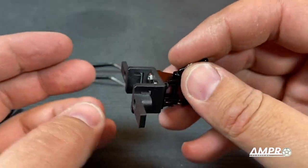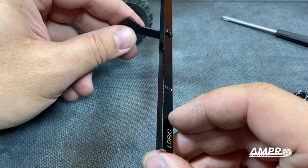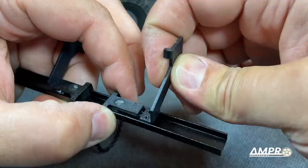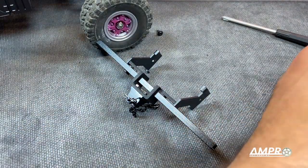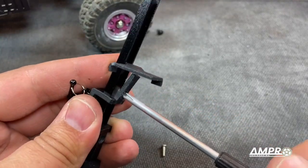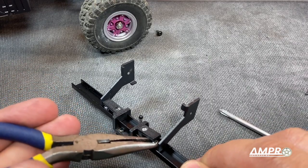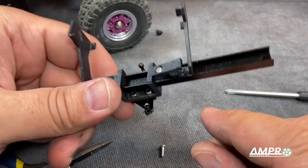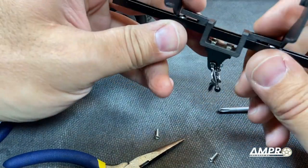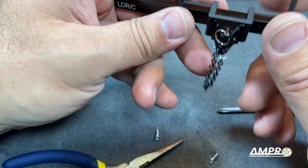Let's go ahead and slide it on. My LDRC already has it, and I'm going to have to pull off all four screws and lock nuts. With the back bumper removed, you can see this little C-channel right there in the plastic — just go ahead and slide it right on in. You might be noticing something, but I guarantee there's a method to my madness. Take the screws that used to be here and thread them in. The brackets are there so you screw this down a bit — you see how it pries it off? Well now you have access to the nuts. Hold it in place with needle nose pliers, tighten it up, back that out and you're good to go. Back the screws out and there you go. Your version of this won't have the play — mine, as usual, I get all the leftovers.